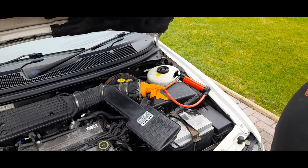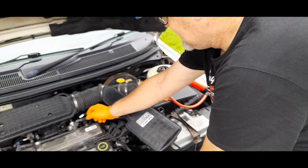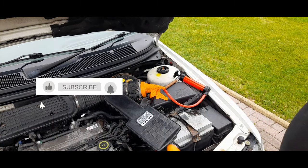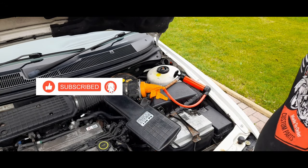Now, on these Mondeos, they've got vacuum hoses — most cars now might have got vacuum hoses here, here, here, under here and there, everywhere. Vacuum hoses. If you get a vacuum leak, what it can do is cause a misfire, and also stop the car from completely starting.